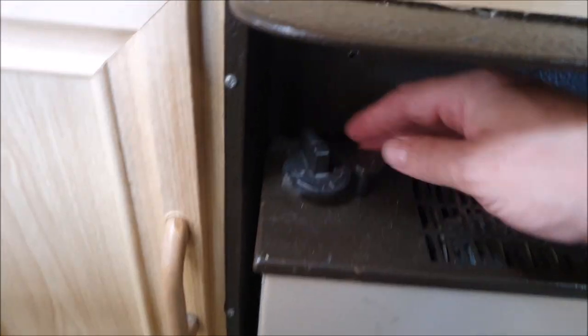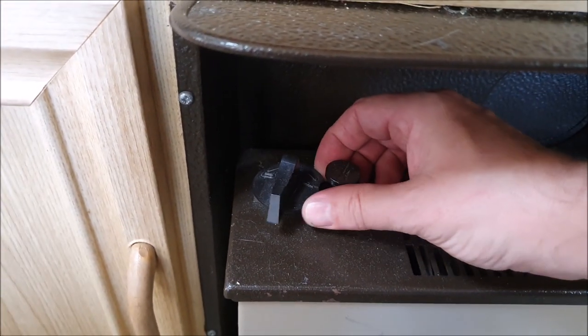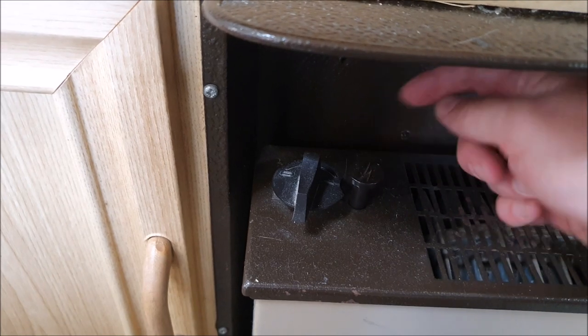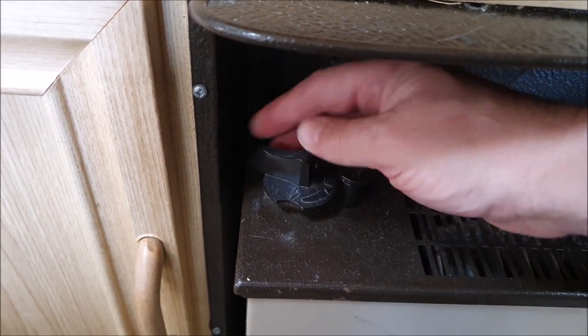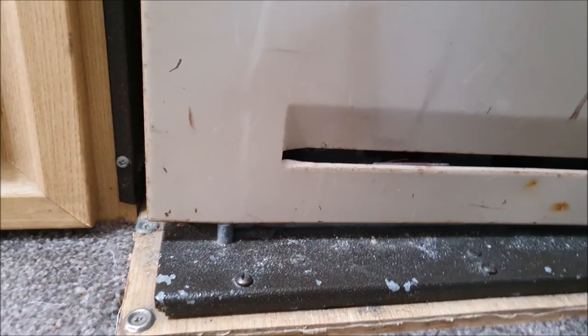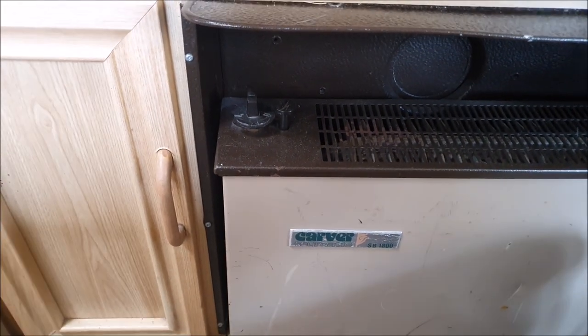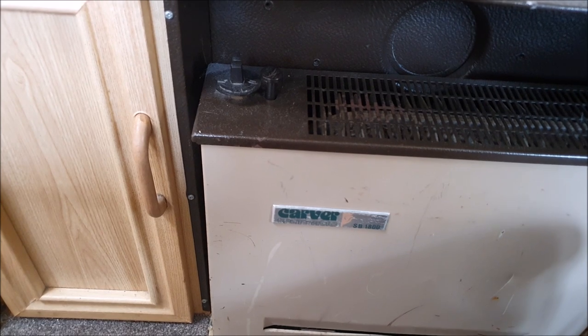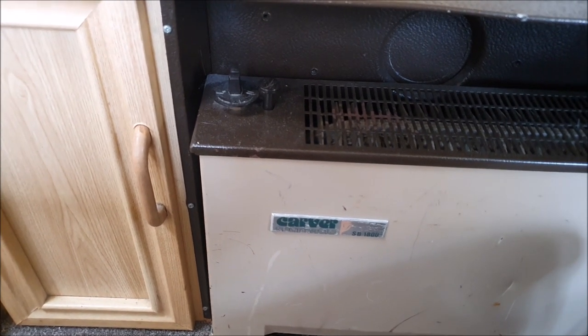There is a little gas cock in here - ours is turned off. You turn this knob until it's on the igniter setting - there's a little cutout in the knob that allows you to press the igniter down. If operating correctly you won't see much of the flame. If you see an orange flame through the bottom there, it's probably not in the best condition, so best not to use it and get it checked out. You should get all your gas appliances checked at least annually.